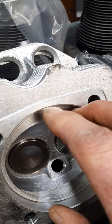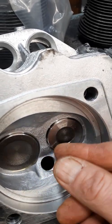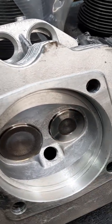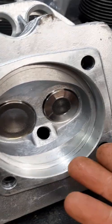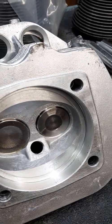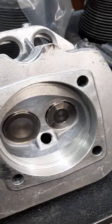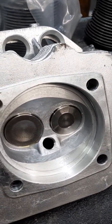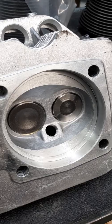So you take it out of the combustion chamber to change the combustion chamber size. When it's machined down, you actually have a smaller volume in here, which is fewer CCs, which causes less volume and then an increase of pressure — that brings up your compression ratio. Right now this is calculating out on an engine calculator to about 6.7 to 1, which is way too low for a 1600 with a decent cam. So I'm going to crank it up to probably about 8.5 to 1, or maybe top out at 9 to 1, trying to make it a very streetable engine.